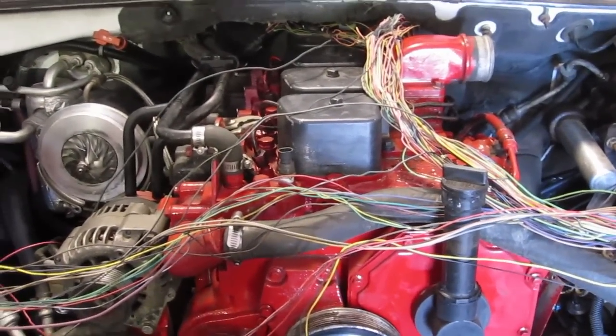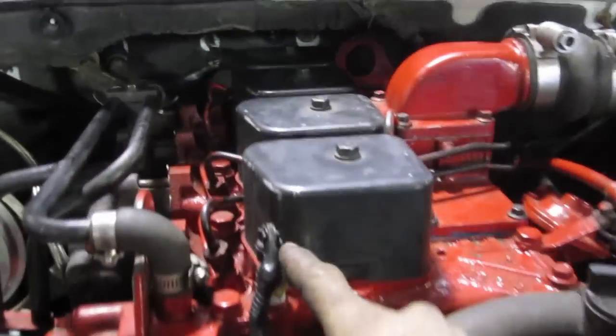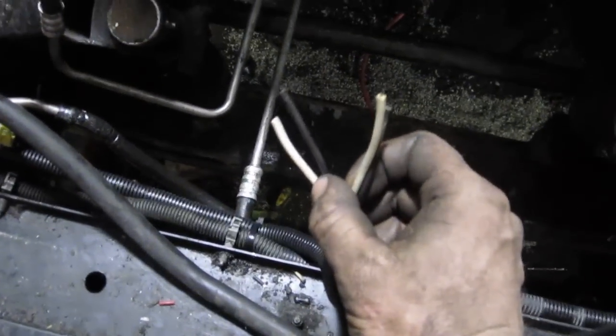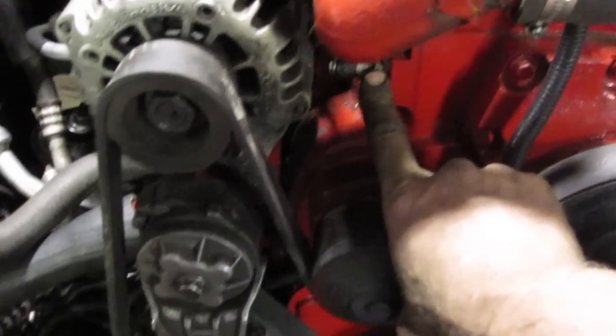This is the engine all wired up. The only wire you'll be able to see is the temperature one on the top. We've got our RPM sensor, and we've added a sensor that connects to ground at 170°F — this will turn the fan on. This wire will be connected to ground as soon as it reaches temperature and that will turn my fans on. I've run four extra 12-gauge wires for my fans and they're going to be turned on with a relay, so once the relay gets ground through the sensor it will turn the fans on.